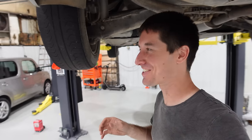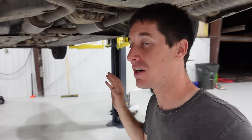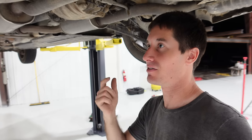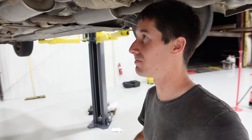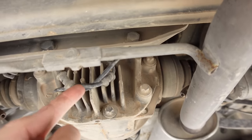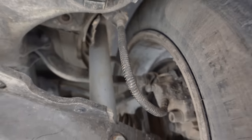Underneath the car: the Pirelli tires are dry-rotted and gone - you can see the wear bars and the siping is shot. The brakes all the way around are completely toast with big lips on the rotors; they'll need rotors, pads, and sensors. The brake light is on and we can't reset the e-brake. We've got some wires tied up by the diff which are probably the solenoid control wires for the air suspension. The coilovers look like Max Speeding Rods - silver painted, black springs, zero adjustment.